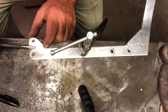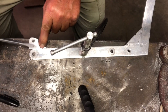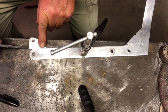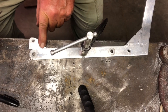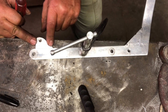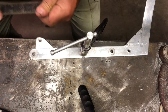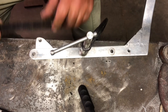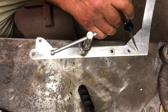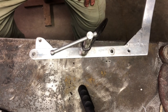Now we've got this laid out on the bench. I'm not real happy with the way this part lines up and hangs over the front of the backrest. The old bag used to be in the mounting hole and I really didn't anticipate having this gap in the front like this. So what we're going to do is move this back about an inch, and then I think we're going to have to relocate the rear holes. I like the position of that much better. This is the rear hole and we'll need to re-drill that about an inch back, and we'll come back and weld this hole in. Then we'll weld this part on and I think we're set.